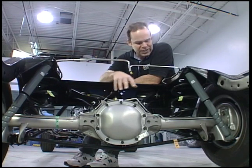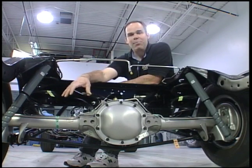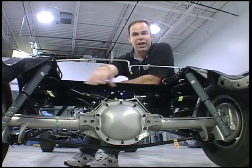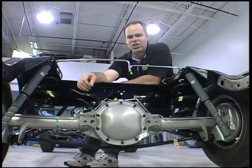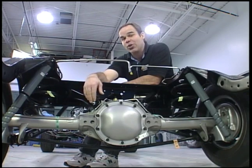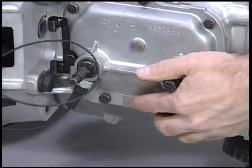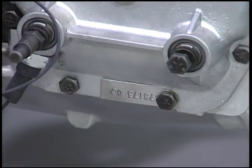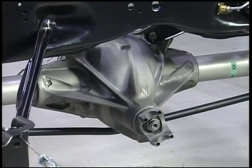After the body is lowered down on this, there's a blackout procedure that happens back here — they literally just painted all over this to try and make it black so it wouldn't look quite as shiny underneath. Now how about the transmission? That's another story. This car came with the DJ transmission and the tag tells us that, and what that means is it was a wide ratio, which means the rear end gear ratio was a 3.55.